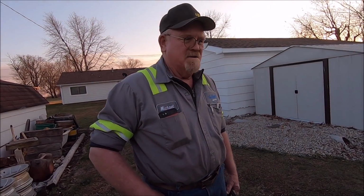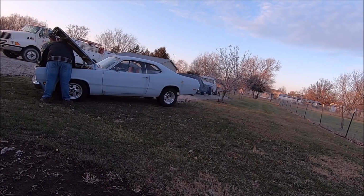As you can tell, it's been a nightmare. So what we're having Dad do now is we're gonna have Dad squirt ATF down the carburetor, old farmer's trick basically, and kind of like water. We're gonna try and use that to clean the engine out. And if it doesn't work, it doesn't matter. This thing's coming out anyway. So let's see about it. Give it a try. Give it a try.